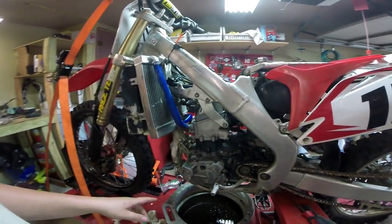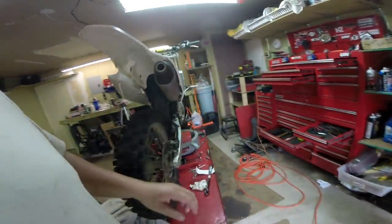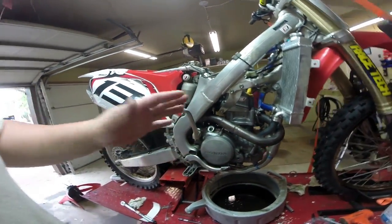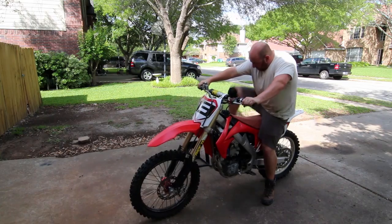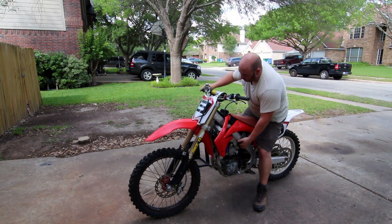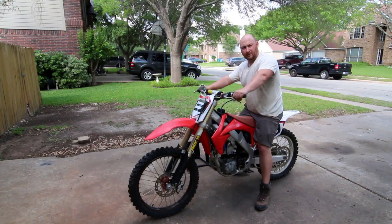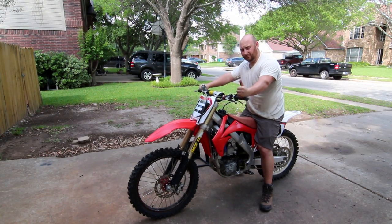I got water in it. Last thing to do is put oil in it. This is the engine oil fill, and on the other side there is a separate oiling system for the transmission. What you want to do is put about 670 to 700 milliliters of oil into each side. It's kind of a clever system — half two-stroke, half four-stroke in the sense that you have separate systems. We actually drained everything when we took everything apart. So we're going to put 700 milliliters of oil on each side, put the tank back on, and I think we're ready to fire it up.